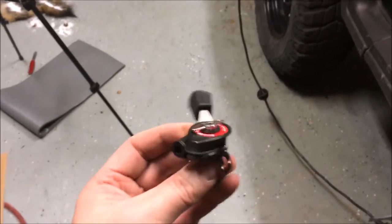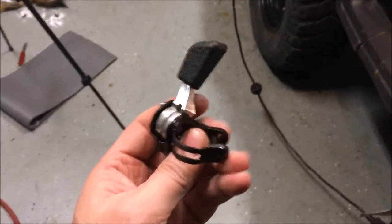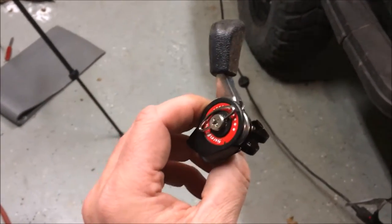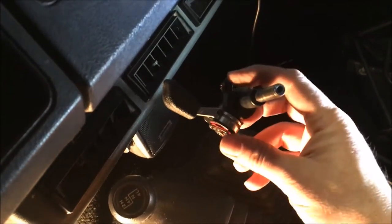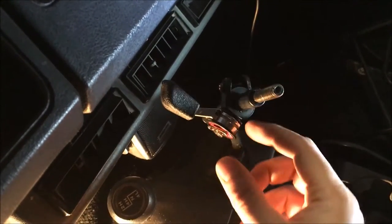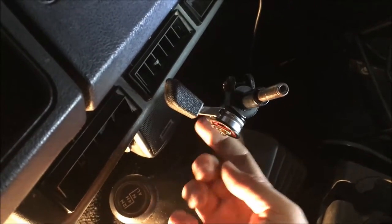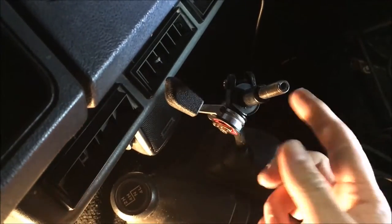This is the actual little lever — kind of like a lever off a 10-speed bicycle for changing gears. We put this over the rubber gasket and that's what holds it on. Then a little metal clip goes around the rubber gasket — mine was a little out of round so I had to tweak it to get it on there. Set it up so the cable points down so you can route it out.